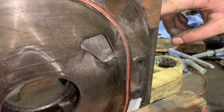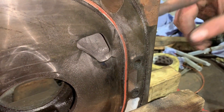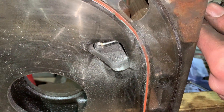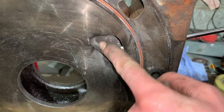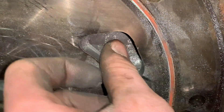All I'm going to do around here is open up a little bit for more volume but not much, and mainly clear the casting marks. However, down here there's a huge lip that needs to be removed in order to have a nice and smooth airflow. You don't want to remove too much and make it a square, but you want to remove just the sharp bit so it's much more gradual.